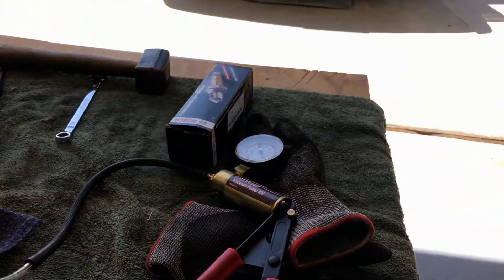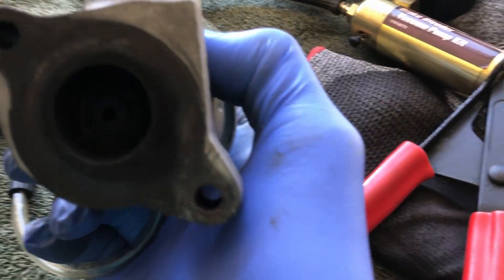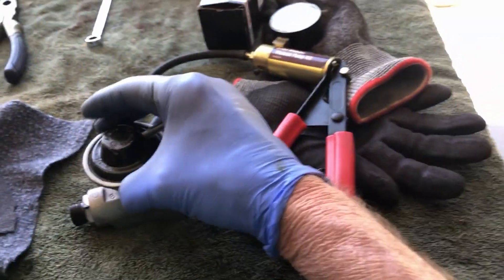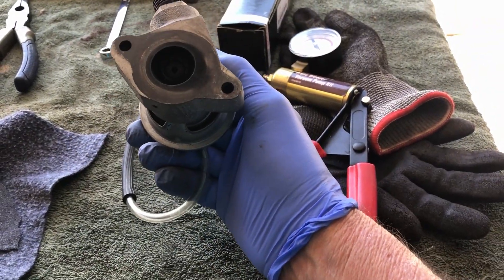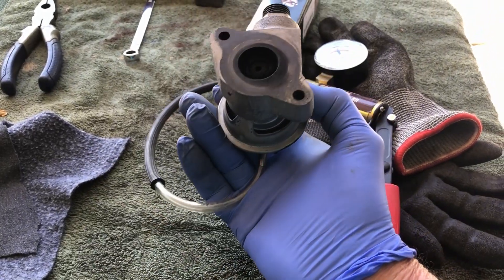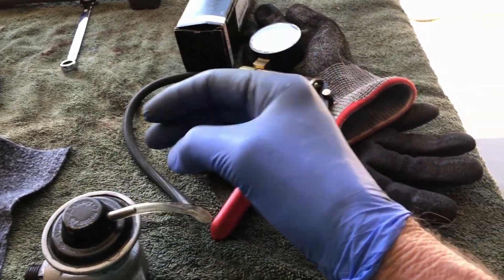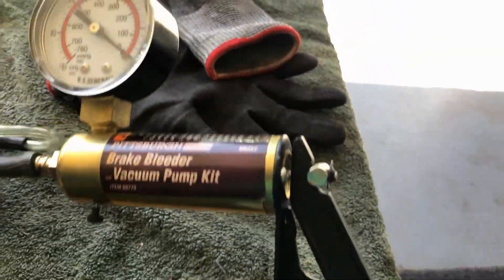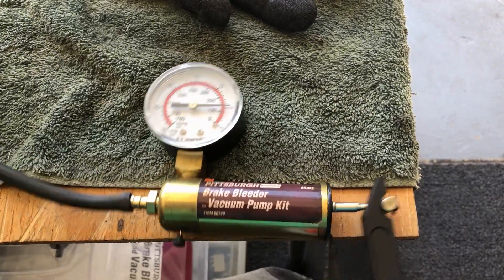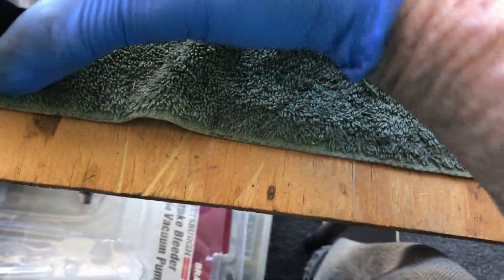Okay, next day I got the EGR valve out. This is what it looks like. Being a 1992 300E M103, it only has this one connection for the pipe for the exhaust gases. I've got this on and just double checking - it does pump up but it does not hold vacuum.